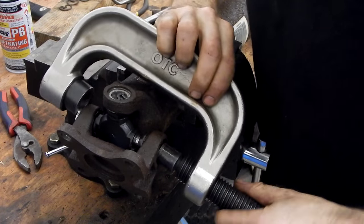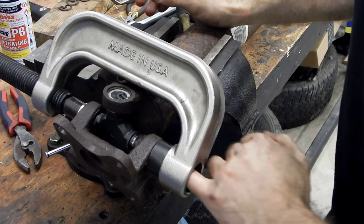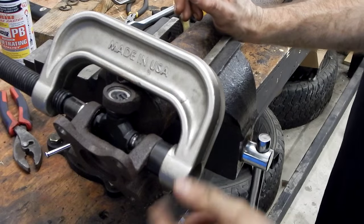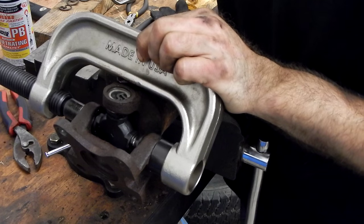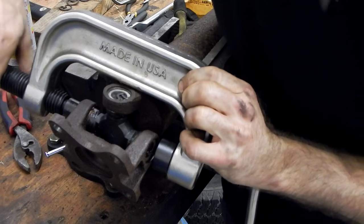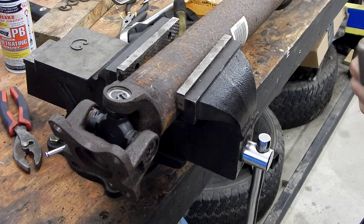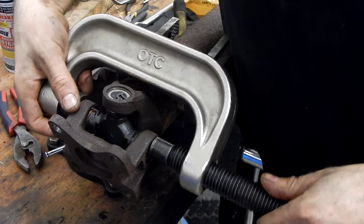So that's on far enough. We knew to flip it because this one got seated far enough into our flange where we'd be able to put our snap ring in, and it pushes more from here — this is going to push this in while this holds. We're going to push this one in the remainder of the way and that should seat it. I pushed this one just a tad bit too far, so our snap ring groove is covered up slightly. I'm just going to come back and push this one in just a tiny bit — it really only has to go about a millimeter.